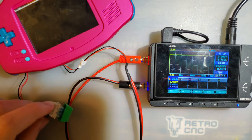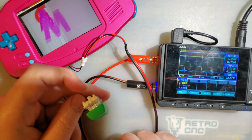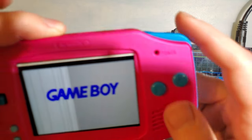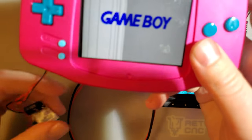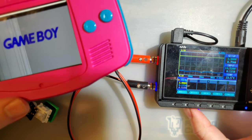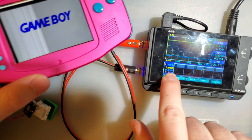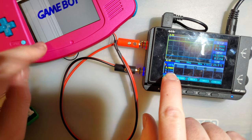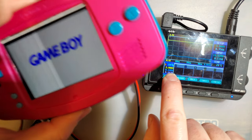Just to verify that everything is working — it is on as you can see from the lights on the output — and we do have a green light in there. The screen is broken but, like I said, good enough for this. With the IPS kit at its default brightness — it does have memory on brightness level, I have no idea what it's set to but it's not going to change — it's pulling 153 to 195 milliamps.